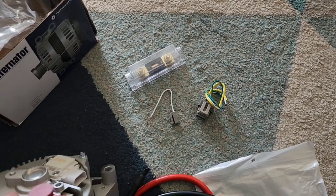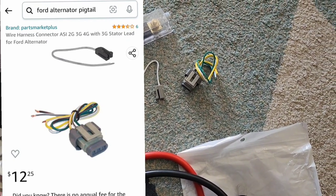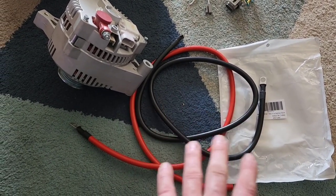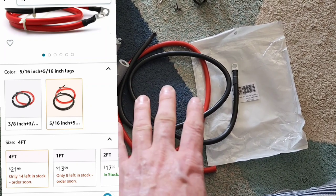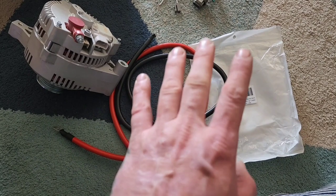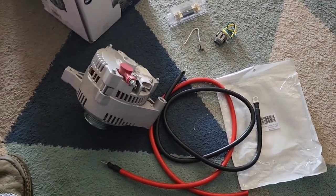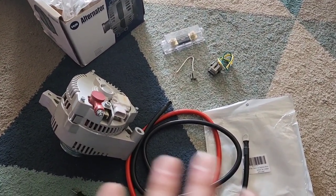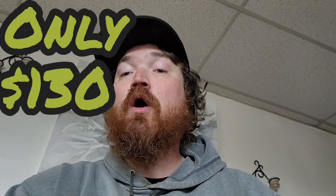To fit into this alternator you're going to need these two plugs — I found them on Amazon for $12. You're also going to need some four-gauge inverter wires with a 5/16-inch end. You'll want a set of 24-inchers if you've got a stock truck; I got four-footers because my batteries are inside my cab since I'm building a race truck. I've done this swap cheaper with junkyard parts in the past, but it's getting really hard to find those older '90s vehicles in the junkyard. I only spent $130 in all brand new parts to do this swap, so it's well worth the money.